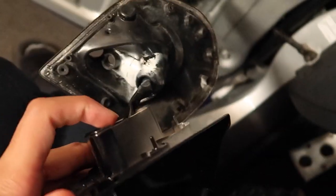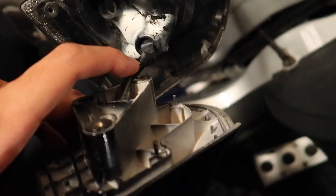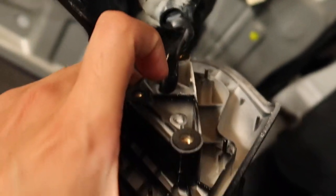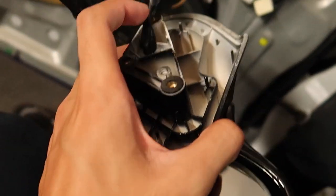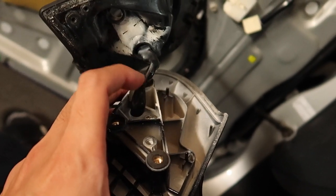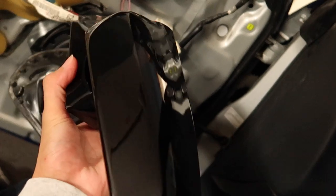Let's go. So basically what happened was, I guess when I got it painted, my boy's dad — when he took it apart — he didn't wire the loom in properly, so it kept getting stuck somewhere in the edges. Basically what I did was there are only three screws that hold the base and the mirror itself together. I just took it apart and readjusted the loom so it wasn't getting caught in the way. And yeah, check it out — it just folded on its own.